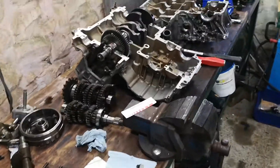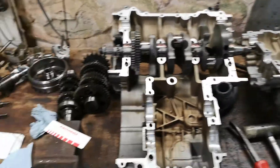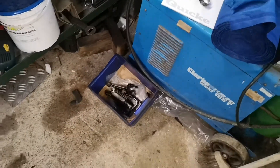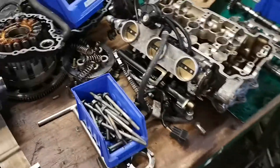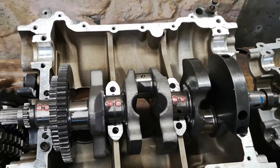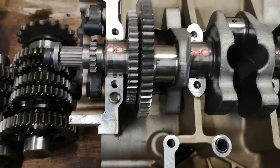Here's an update on the carnage - as you can see, things have progressed. The old crank is on the bottom shelf because we don't need it, along with some con rods. We have a new secondhand crank which we're just plastigage-checking now.